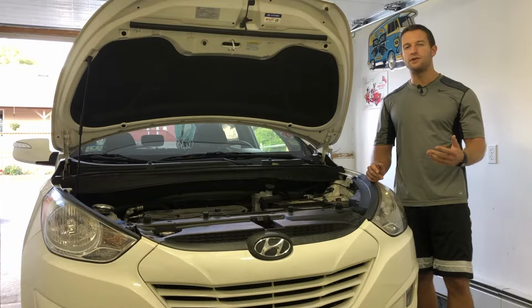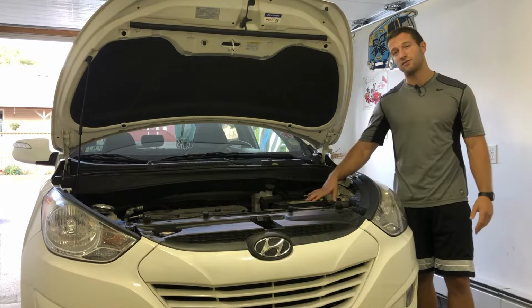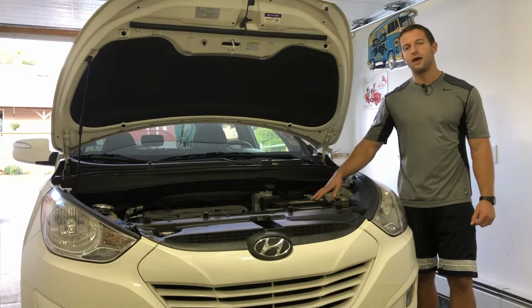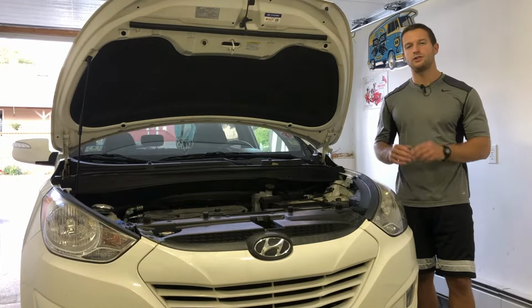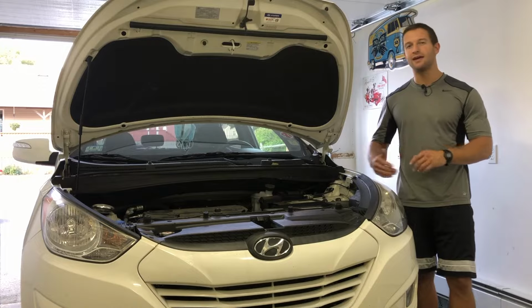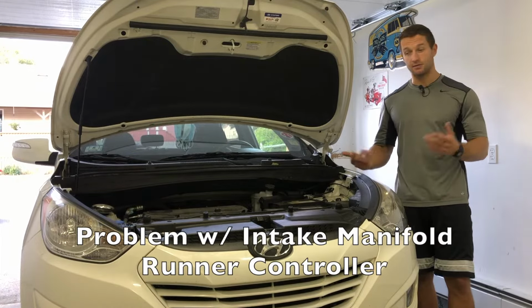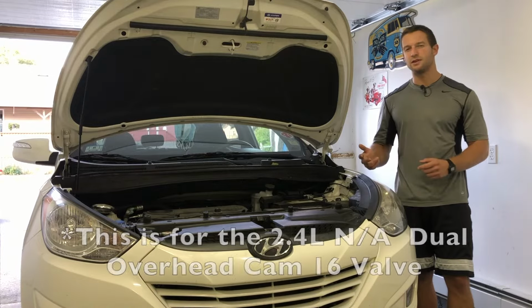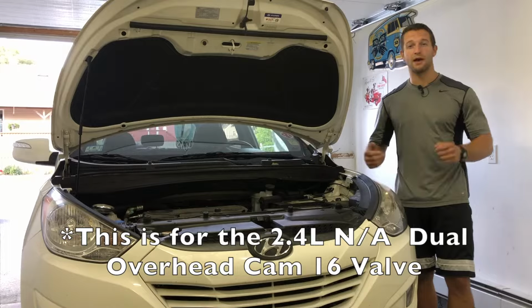Today's going to be a follow-up video of when I showed you how to scan your check engine light. Today I'm going to be working on my girlfriend's 2013 Hyundai Tucson, and we're going to replace the part that is apparently throwing the code to give her the check engine light. The check engine code was P200A and P2004, and that was showing a problem with the intake manifold runner controller. So today I'm going to show you how to replace it. I did notice that there's not too many other videos on YouTube showing you how to fix this part. So let's see if this one will help you guys out, and I hope it does.